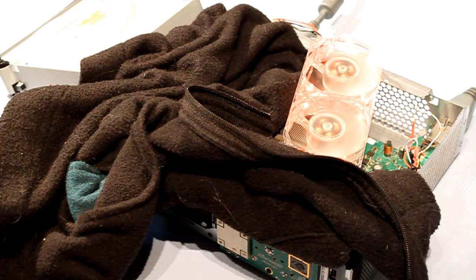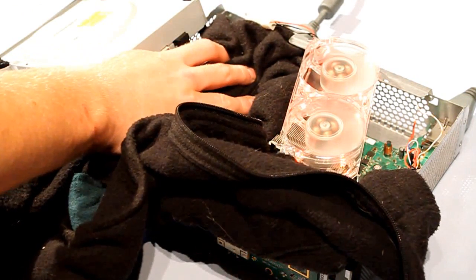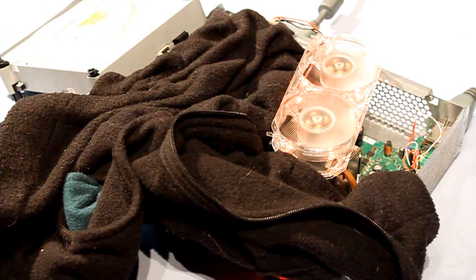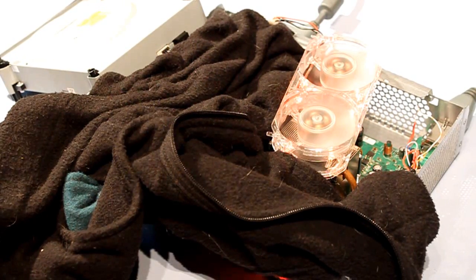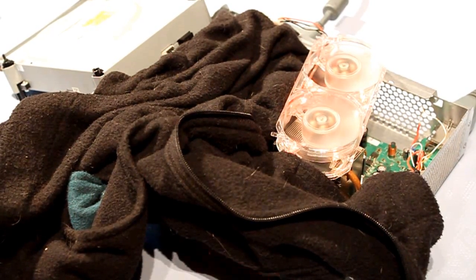It's not really a set time — you want to get it nice and hot so that if you touch the GPU heatsink it literally burns your finger. You can either leave it on for maybe half an hour to an hour. I sometimes leave it on until the Xbox itself shuts off because it has thermal protection. It'll get hot but it won't burn the sweater or anything. After some time the fans will start to speed up and get louder, but that's fine.